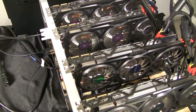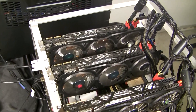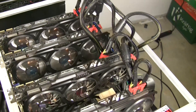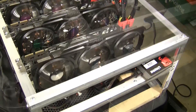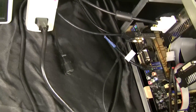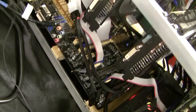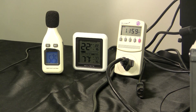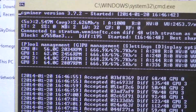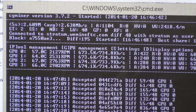We were really determined to get this rig running all four cards on the 1200-watt PSU. Trying them at 1060 core with 1500 memory, we were pushing around 1,350 to 1,380 watts of power, which was killing the box after about 10 minutes as the fan spooled up cooling the cards. So we asked: just by adjusting the core, could we stabilize the rig? Adjusting the core alone, the kilowatts shot straight to about 1,200 watts, and the cards cycled down to about 675-680 kilohash per second each — indicative of bringing that core clock down.